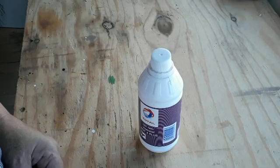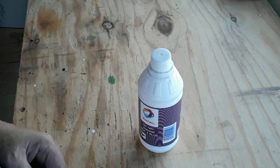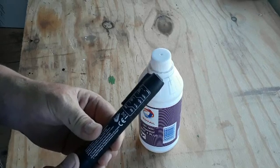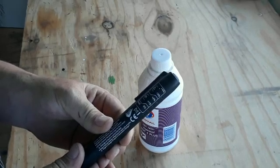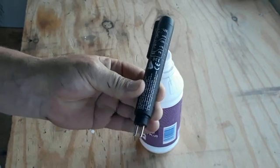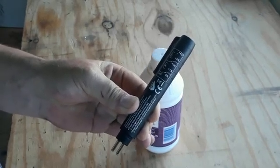The big question is: how do we know how much moisture is in our brake fluid? For this we've got a very handy tool — I picked this one up for about 200 South African rands. It is a little sensor with two probes that you put into your brake fluid and it will tell you the amount of moisture in it.